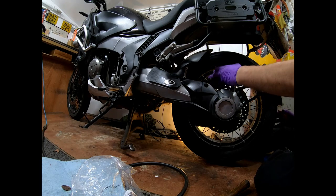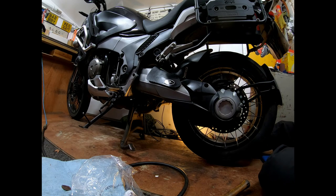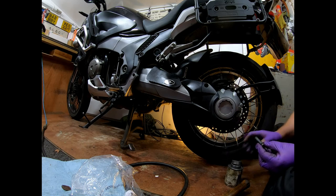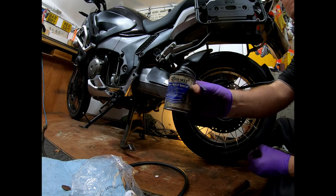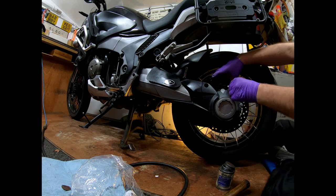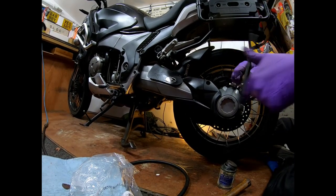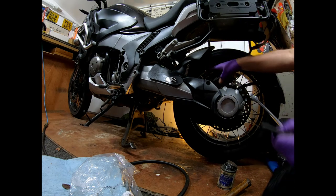this, with a bit of fiddling again, finding the right gap in the spokes, just falls in like so. Again, the bolts that I use on and off, I give them a copper, a pure nickel seal. You can see that. I'm trying to get it in the camera. You can see it all. Nickel seal, which I swear by. It's a great, brilliant item. So, look at that one. Just go over the camera. Get my T-bar. Just gently wind that in. Like so. So, that's one in.